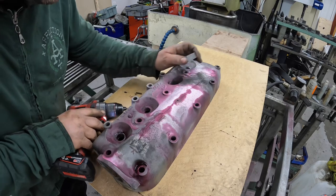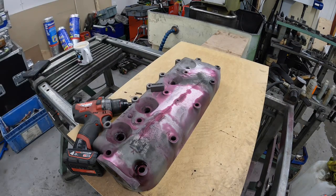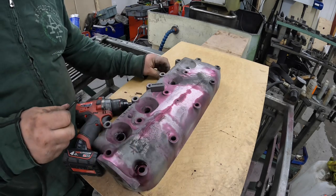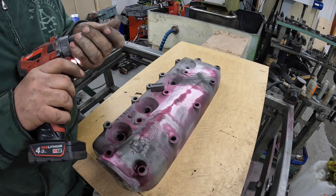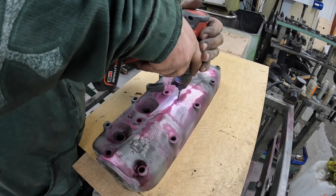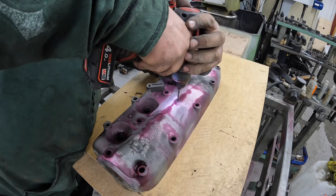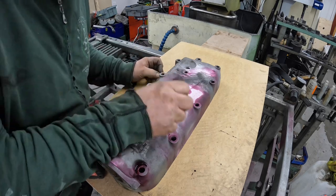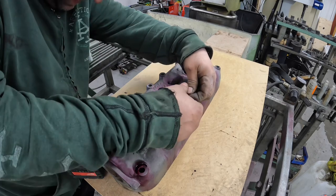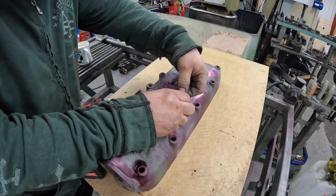and then once I've got the one hole part in there, use a drill bit with a squared off end like that to give it a nice flat bottom instead of a drilled bottom. Just like that. And then basically I can use this little pin through my locking tool and into the hole like that.